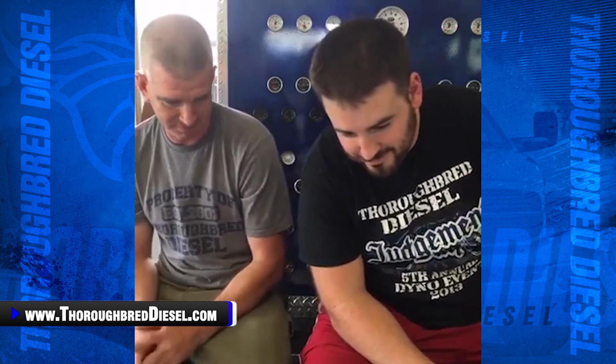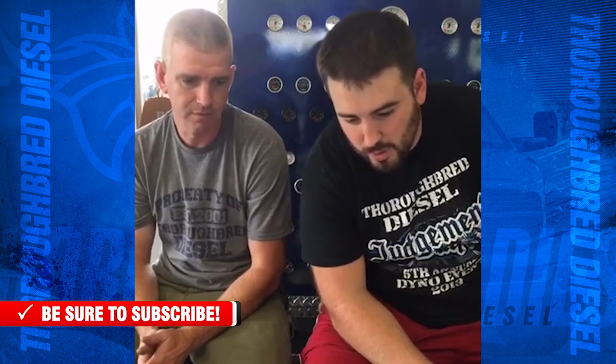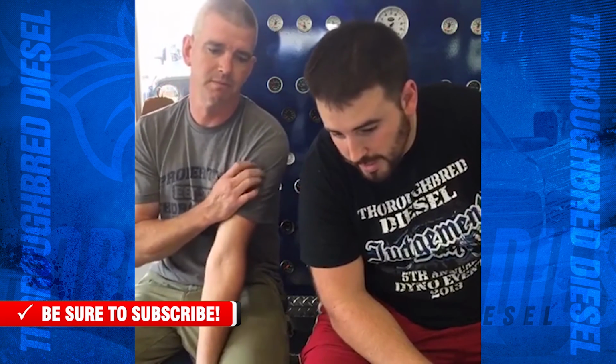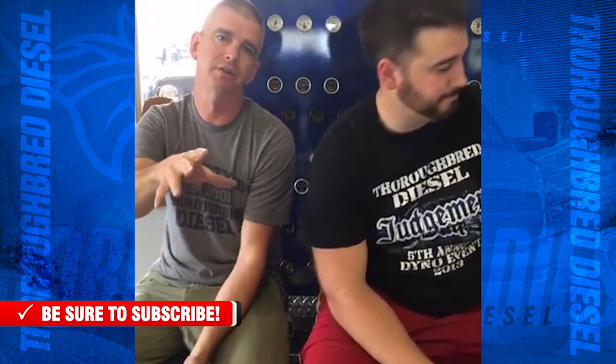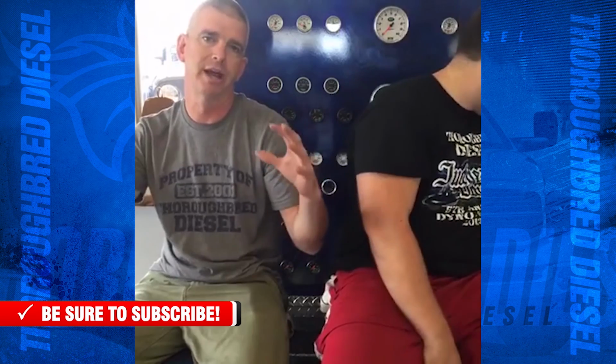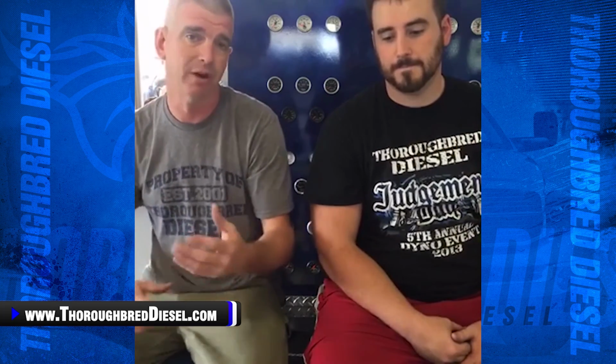What's the advantage and disadvantage for going single turbo on a 6.4? Turbo's going out, can't decide between upgrading compounds or going big single. Advantage on the 6.4 is you're actually just going to get an easier engine compartment to work inside of, which is, to me, a huge advantage. And for somebody that's going to try to work on their own truck, that's going to be a big advantage for you. You're not going to lose anything as far as still going to have good top end with the turbo. You're still going to have awesome responsiveness.